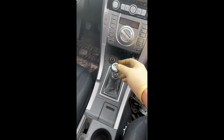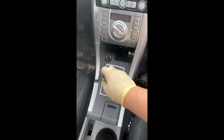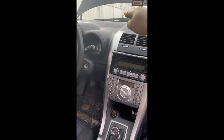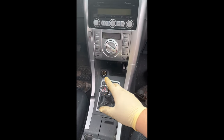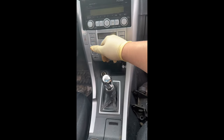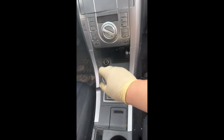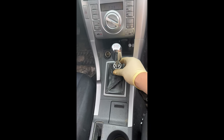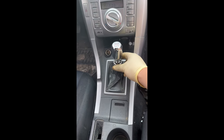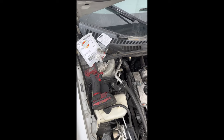She's on, guys. What I realized is that it does feel a whole lot better - I don't really have as much play as I used to. To fix the remaining play I'm going to try replacing the bushings where the cables connect to the transmission directly, to see if that fixes it. I noticed a lot of guys who did this install had issues with the shifter hitting up against the AC or the head unit over here - I'm not having that issue. I have to figure something out for this; I'm going to run a thread chaser all the way down so I can put this nut where I want it.